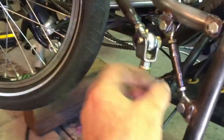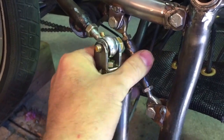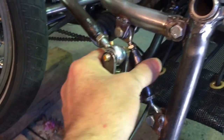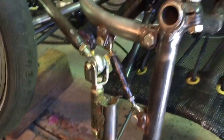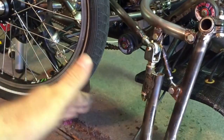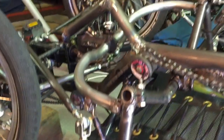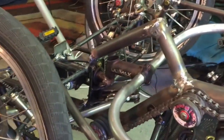I've put little twist adjustment units here with left-hand thread and right-hand thread to allow adjustment of the angle of the steering levers, so you can angle the whole lot forward or back. The rod ends also have adjustment to hopefully customize the vehicle to the appropriate lever size for drivers of different heights.